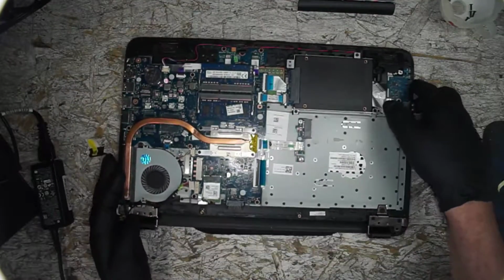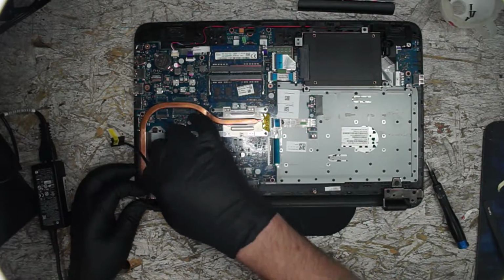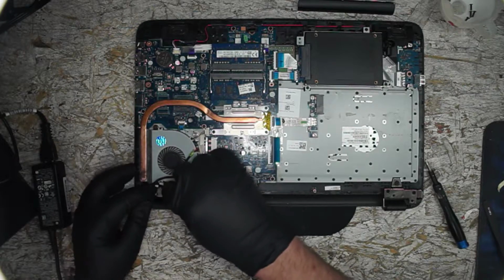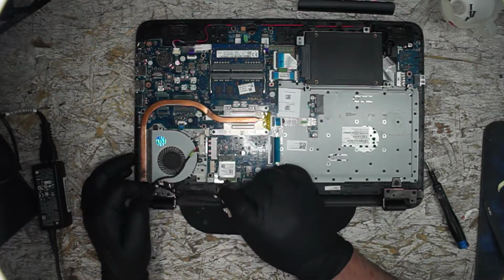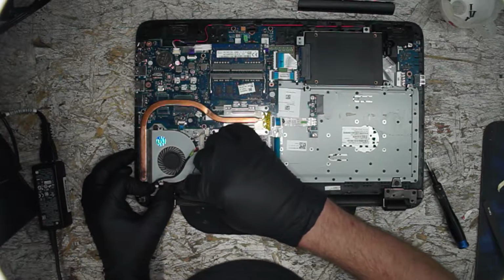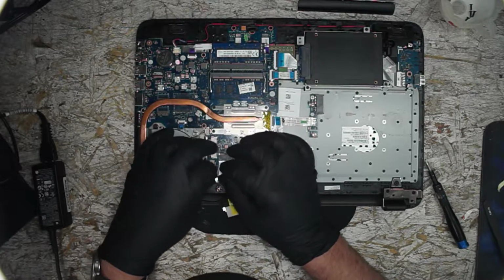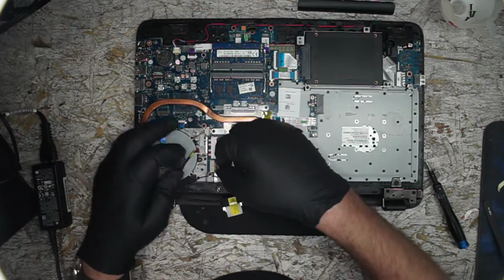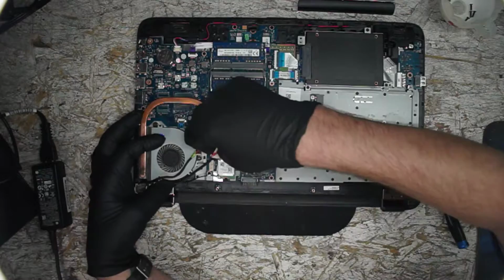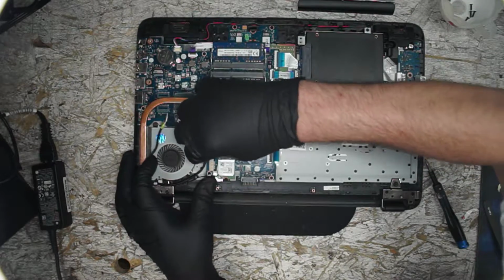Okay, we have them wrapping the bottom. Our bezel is back on there. Now we have to feed these 2 wires back to their location. That one, and then the one for the DC jack. Right, Wi-Fi is fairly easy. It jumps down. Could probably actually go under the fan, but we're not going to get fussy with it. Not today. No time for that wrap. No more monkey business. It's only Tuesday. Alright, then we have this coming over, and we have to stuff it in there. Looks good.